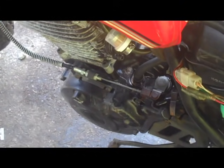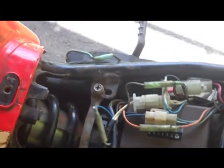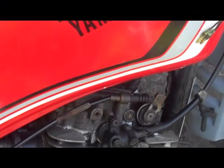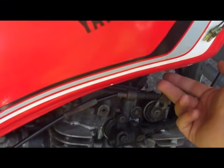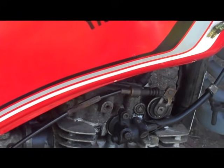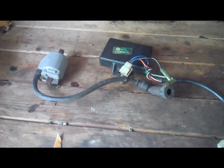This is basically how everything works: a little bit of current comes up from your stator and your pickup coil down there, comes over to your CDI box. Your CDI box determines when it's going to send the spark. The spark goes around here to the coil, which typically lives right up underneath here, and then that runs through the spark plug wire and to the spark plug and into your engine, where it makes a spark.